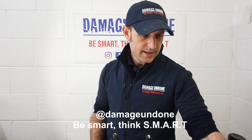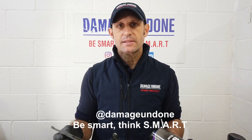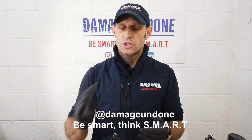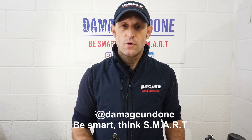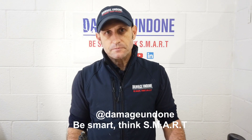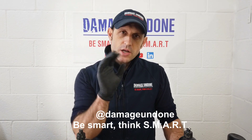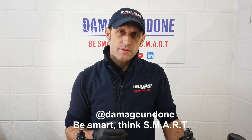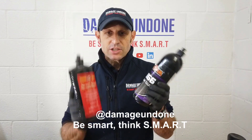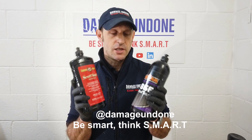The way you use it: you just need a little gray Scotch Brite, put a small dollop on there — about a 10 pence size or Euro size — add a little bit of water, squirt some water on it, and just key up the panel, then wash the panel down. It's really straightforward and easy to use. I used to use my Norton prep and blend discs, which are great on big flat panels, but where you've got swage lines or corners they can be a little too aggressive and cut through. Whereas with these two products you don't need to worry about that — there's no risk of cutting through unless you're being really aggressive.